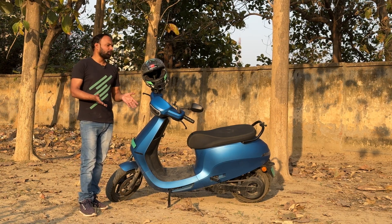Also, you have to do a full charge of your battery every 15 days — it is called cell balancing. It is necessary so that your cells are at the proper SOC level. You will have to get the true range, riding in Normal mode at around 50 km/h. If you ride your scooter this way, you will get a good range.